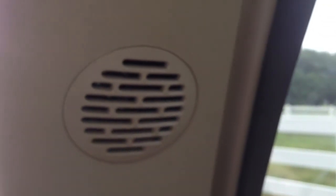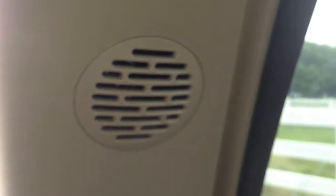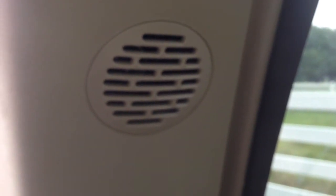Leave the bass blockers in. Once I push some more power to it, it'll be nice to have them. We probably won't put bass blockers in any of the door speakers. The four of those will be 6.5s, and I think they can handle the bass, especially since my sub is only a 6.5.